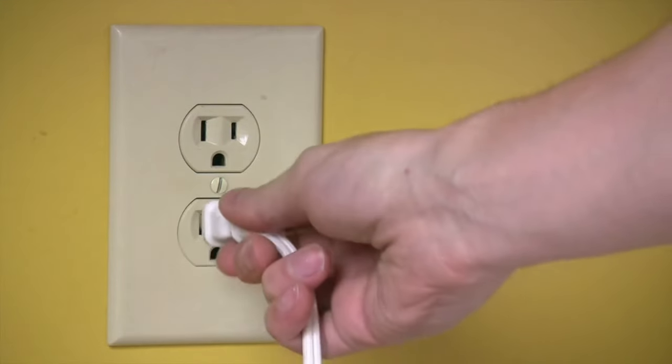Really, you can do things like obviously use less of the battery. That means you can keep it plugged in. Keeping it plugged in all the time, as long as your power doesn't drain the battery, it more or less bypasses the battery. Your cycle count won't increment because you're using power from the wall. And that's a way to keep the cycle count down.